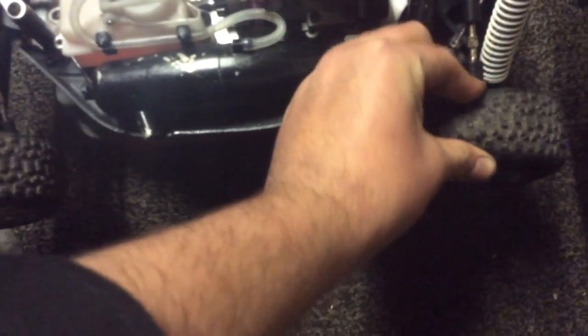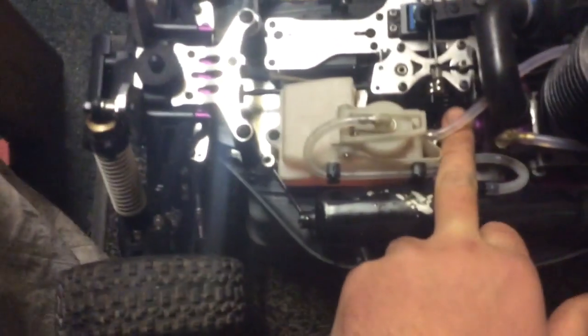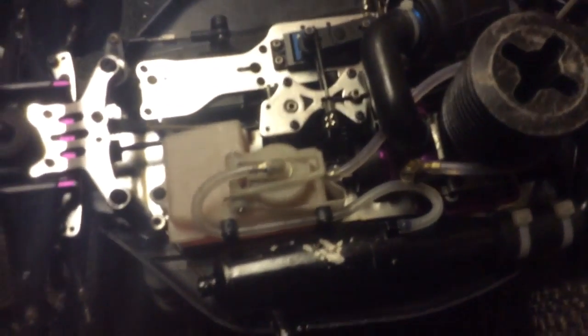As you can see from before, there was a little bit of pizza slicing going on here, a bit of foam swelling. That's that new clutch doing its job, I think. And as you can hear, there was a little bit of a whistling or something like that going on, and I do believe that that's the mesh, or it could be a deeper problem, but I'm just making you aware of that, because it wasn't like that before the rebuild, so I can tell you that.